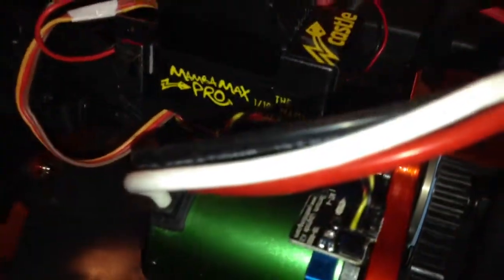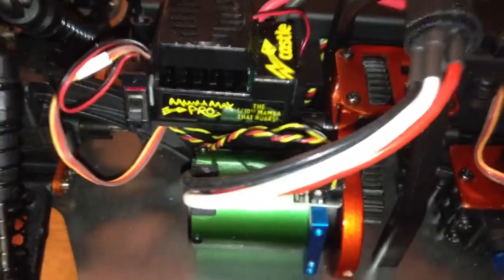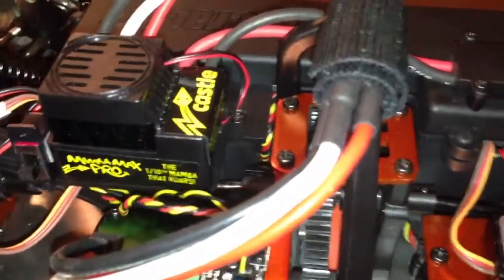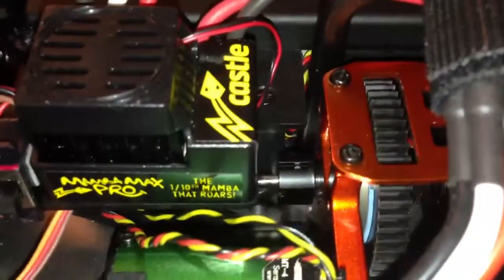Getting a little feedback — not sure why, probably because it's not on the ground with the tires in the air. Another misconception — a lot of people say the Mamba Max Pros' BECs are crappy inside them. I don't know if that's true or not. As usual, I don't take chances, so what I did was I put my own capacitor inside the receiver box — it's underneath the ESC tray. I have a Spektrum voltage capacitor inside the box plugged into the empty slot on the receiver, so I won't have any glitching problems whatsoever.